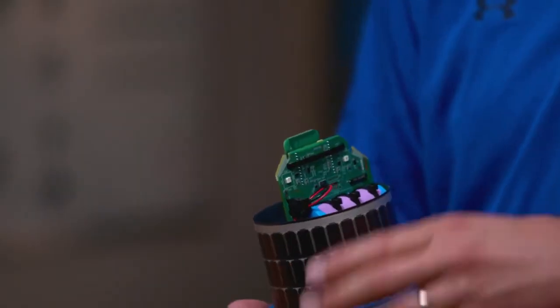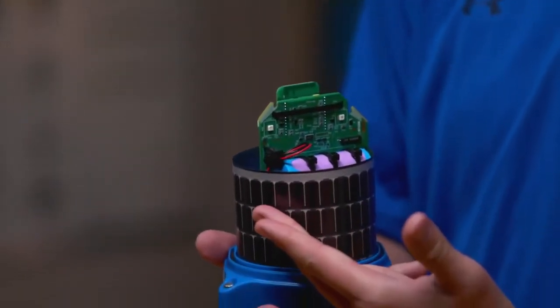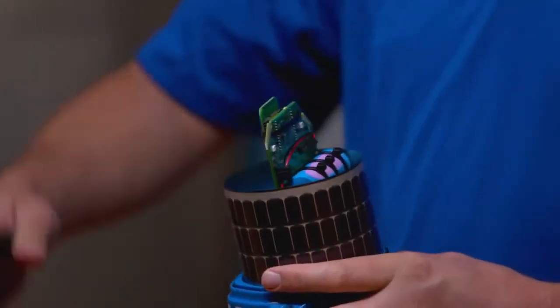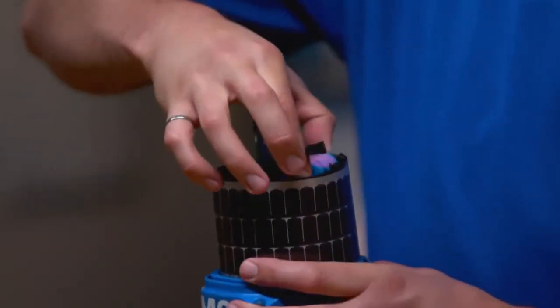You will see the battery is being held there with three black zip ties. The first thing you should do is unplug the battery from where it is plugged in on the left-hand side of the printed circuit board. Next, you should use the clippers to unclip those three zip ties. At this time you can remove the battery from its position.